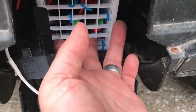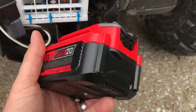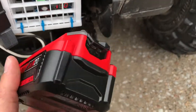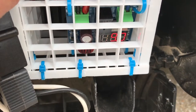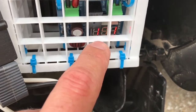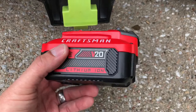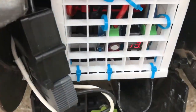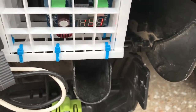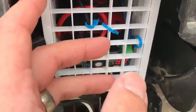Instead of putting another sealed lead-acid battery in there, I did one of these. I already have some Craftsman tools and just got some bigger ones. Down here is a digital readout — this is a low voltage switch that shows you the current battery voltage. In the case of this battery, the actual Craftsman tool shuts off at about 13 volts — I ran it all the way down, that's when they shut off. So I set the low voltage limit at 13 volts here so it'll shut the batteries off instead of discharging them too far and potentially damaging them. They're lithium polymer and those are prone to that type of issue.